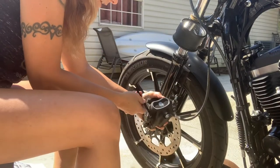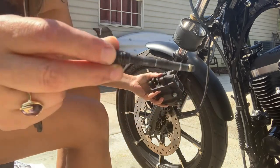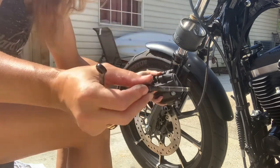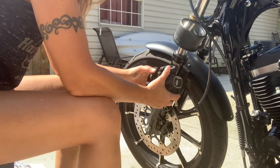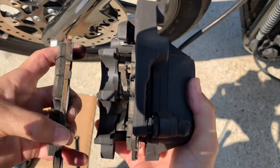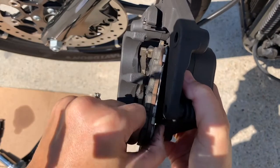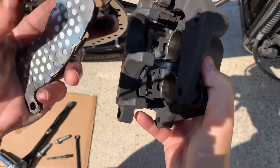Remove the caliper from the rotor, then remove the caliper pin so we can remove the pads. That's what the pin will look like — we'll measure it, see if there's any wear, clean it up and have a look. Now we'll remove the pads. Looks like there's some spider webs or something on them — I'll have to clean that all out. Yeah, they still look like they've got plenty of life on them but there's some stuff in there.